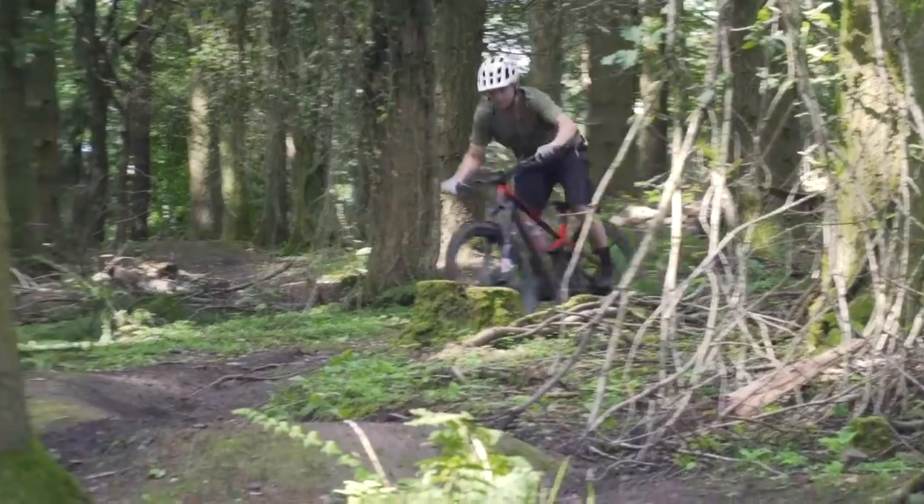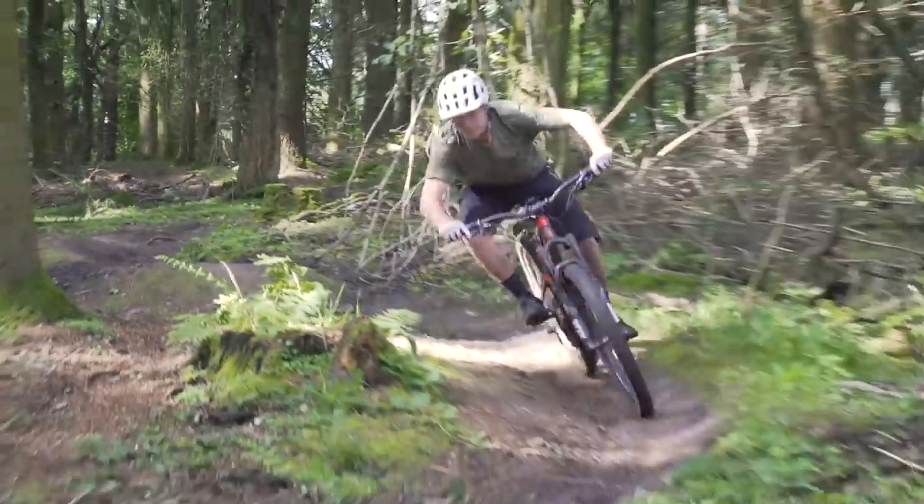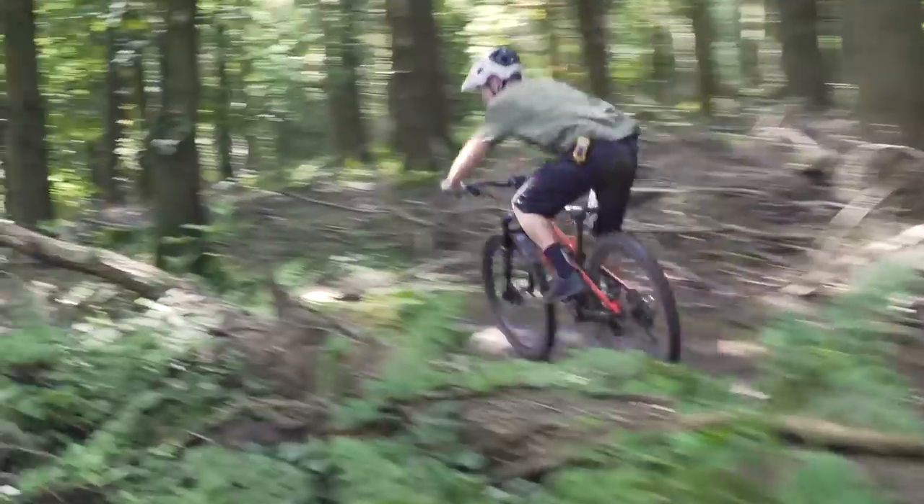I think 180mm is a fair size for the back, but going to a 200mm up front — when you've got a 200mm rotor on the front and you're braking, you have so much more access to better braking that you don't drag the rear so much because your braking distance is shortened so drastically, so it can in turn take the emphasis off the rear. I hope that helps.